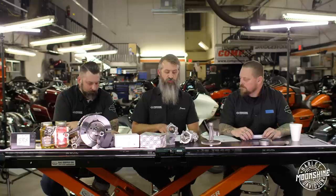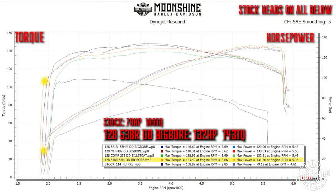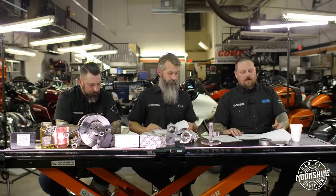The 492 is something we'll use more on 124s than 128s - it's kind of a hybrid cam that makes similar power on both platforms. The 538 came out because we were running the 521, wanted a little more, called Luca at Fueling, and said we want something that runs like a 521 with stock heads but shoots for the stars with ported heads. These graphs show the very first 538 they released - we tested it, gave them dyno results, and it's now available.